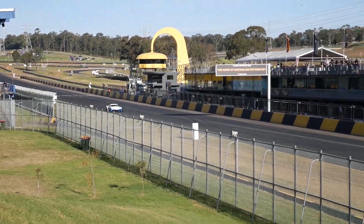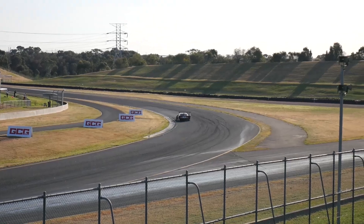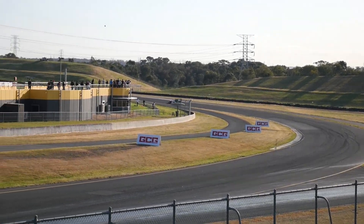The benefits of active damping, particularly in time attack cars, are based on the fact that these cars run significantly stiffer than most track cars. They're often, due to the aero loads, heavily compressed into bump rubbers, and so we're experiencing different spring rates based on their ride heights. Alongside that, we can also vary our damping as a function of speed and position on the track, to favour traction, cornering grip, aero grip, etc.